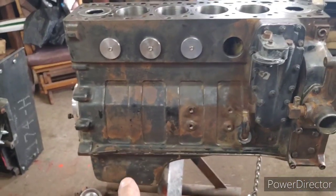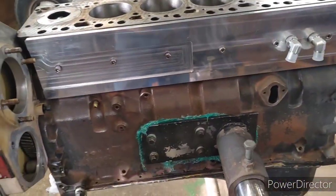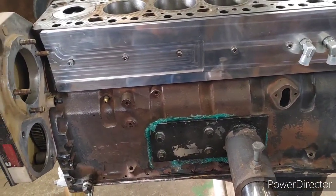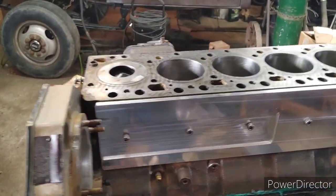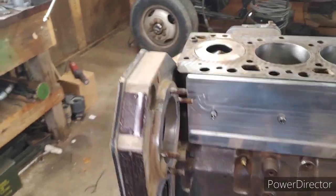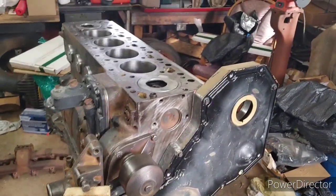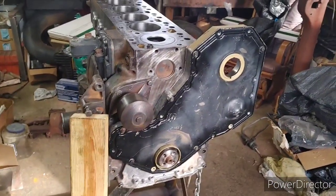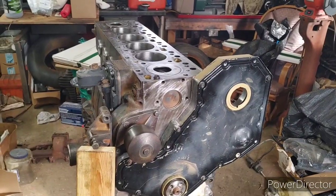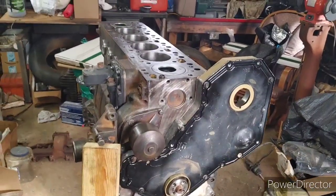The oil pan's on, oil pickup's on. I don't have all the bolts in the oil pan, I don't have a gasket on it because I'm just keeping the dirt out. I'll do that once I get the head on. The pump is at the pump shop — I'm having the injection pump gone through before I put it on, because I don't trust injection pumps. I'm afraid they're going to leak into the oil, dilute it, and that's a good way to wipe out a new motor. Anytime I rebuild a motor I usually rebuild the injection pump too.